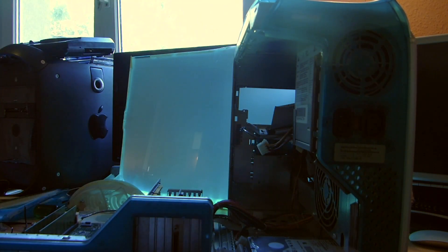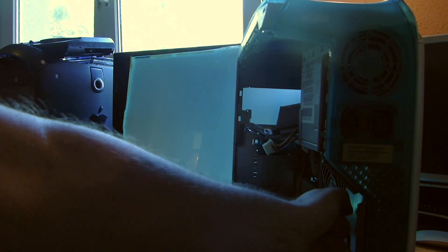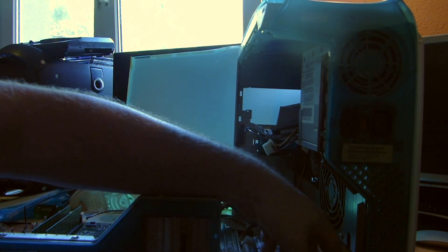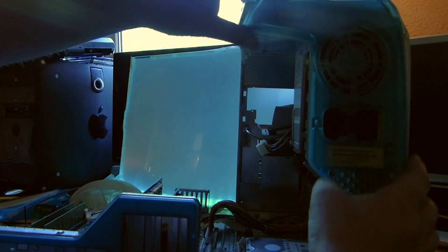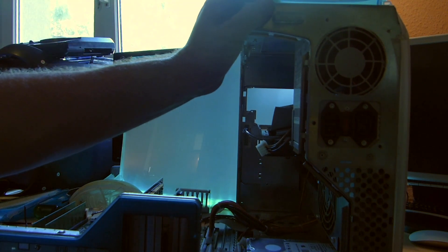This one at the top. Now the back panel is loosened, and on the bottom - you can't see this right now - there are two ledges on the inside you have to push. There are also a few ledges on the top, and then there is one on the side which won't get loose right away. Just have to wiggle it a little bit with feeling, and then just pull it over and it's gone. Now you can just slide this thing out and lift it up.